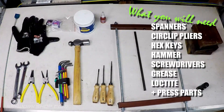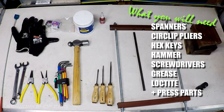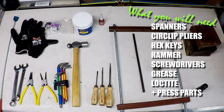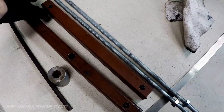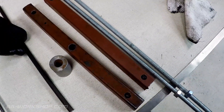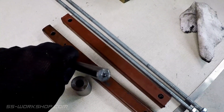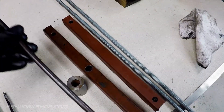To replace the gear, you'll need these tools. You may also require some spare bearings, depending on whether you damage them on removing them. The press is made up of the following parts: two pieces of square hollow section with holes drilled in them, and two lengths of threaded rod. A piece of steel rod with a small centre turned on it, and a slug of steel turned to press the bearing back in and fit over the shaft.